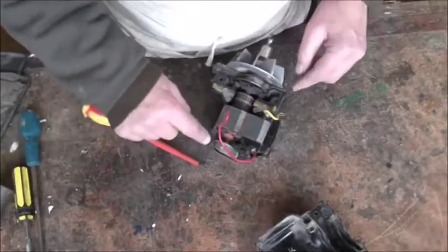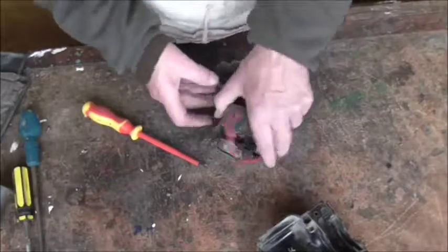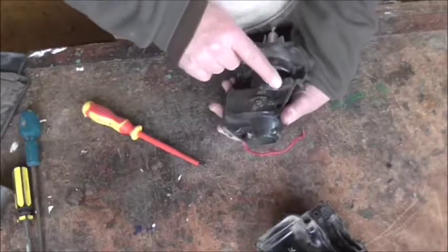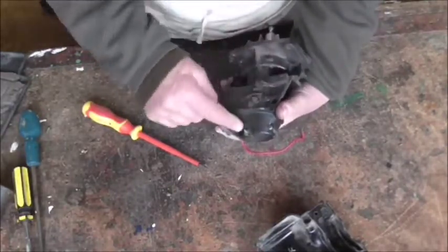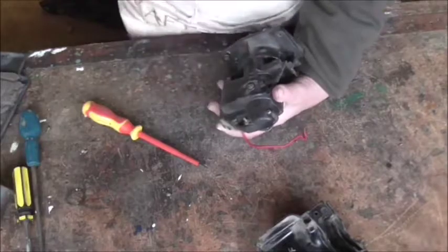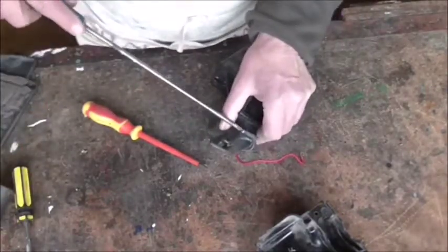The only other thing you need to do is release the two bolts here and the two self-tapping screws there, and we can lift the whole thing out. On some models there's a suppressor capacitor there - it's been removed on this one, as they used to blow up after a while. If you've got one of those you have to take that nut off first. All we've got to do is undo this screw here.